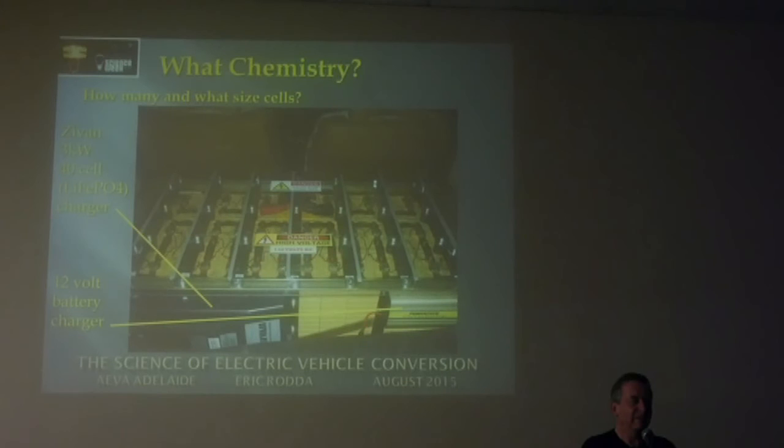My personal opinion is, yes, you should use orange, or if you use red and black, where the wires come out of the conduits, you cover them with orange heat shrink, which is readily available. So they become orange wires. That's what I did with the Prius. I used some oddball red and blue cables in the Prius, but I covered them with orange heat shrink, so they appear like orange cables. That's the one way to do it.